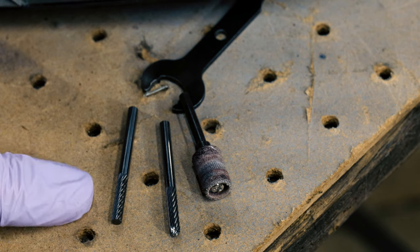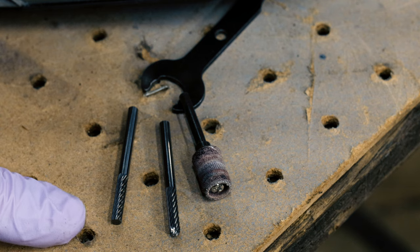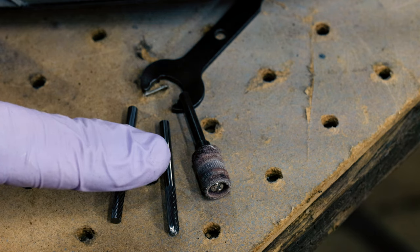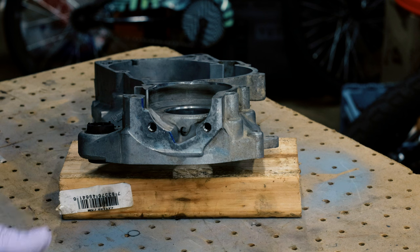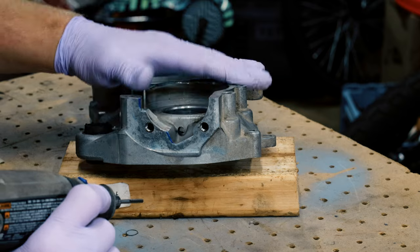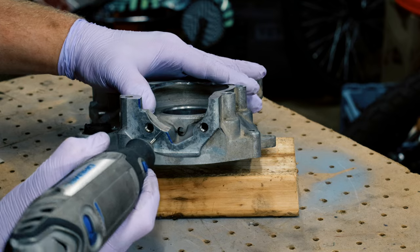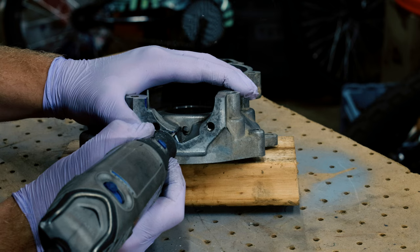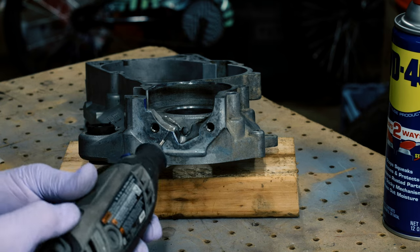To do this porting I'm using these tungsten carbide bits. I really like the rounded one and the flat one — these things eat a lot of material really fast, and I like the round one because you can get into little nooks and crannies. I also like the sanding drums because they smooth everything out. It's pretty messy so if you can do it outside that's great; if not, do it in a designated area. I'm going to start on this bottom one and angle it a little bit into the case to take away that material. If you can spray a little WD-40 on it, that'll help it from clogging.